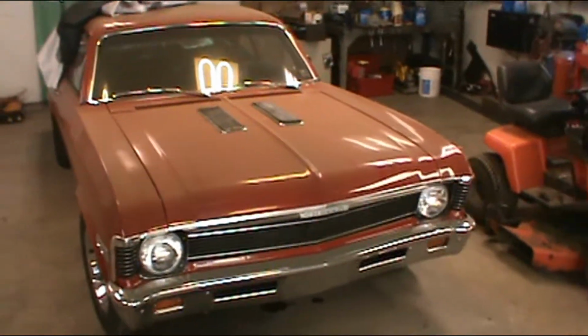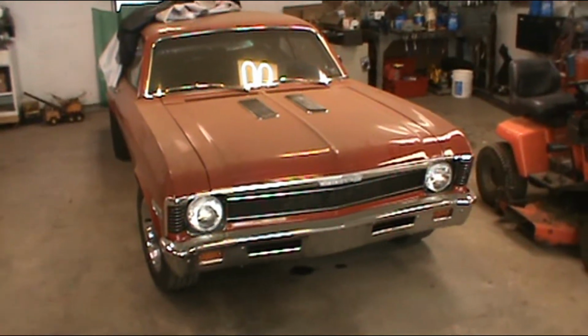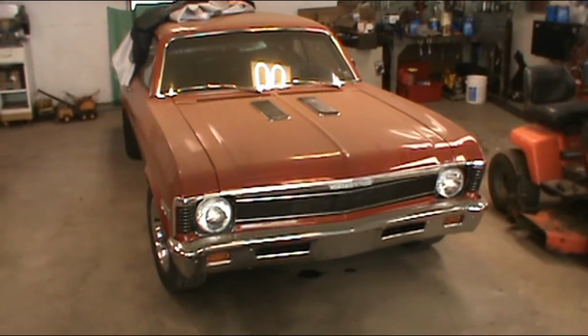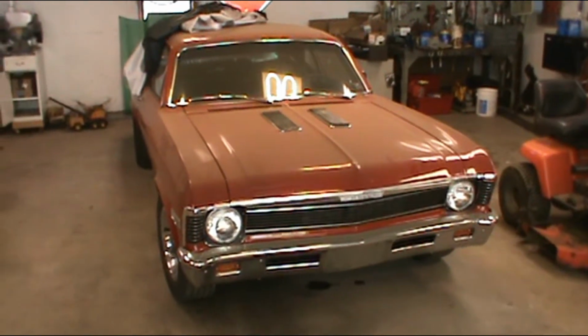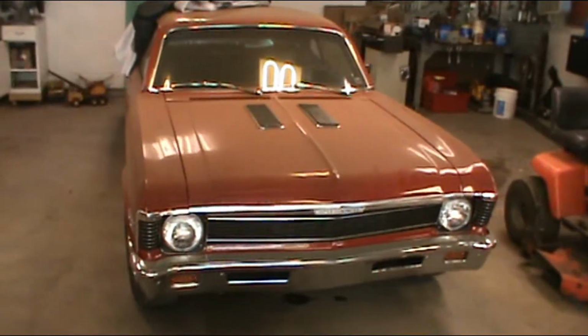The car's something I've been meaning to change. I wanted to redo the pinion gears in it. One of the reasons is I got 411s in it right now, and I think they're just a touch too steep. I still have great highway cruising, but taking off, first gear is way low and second gear is just a little bit too high. So I thought I would get that done.